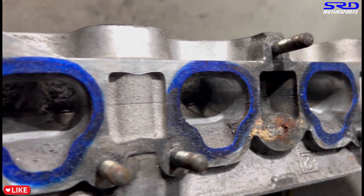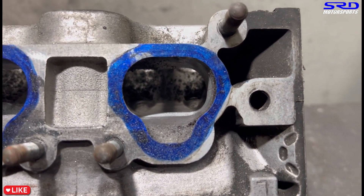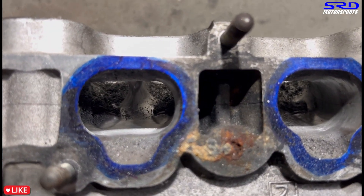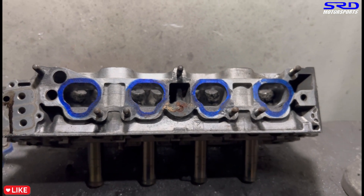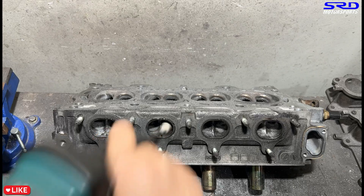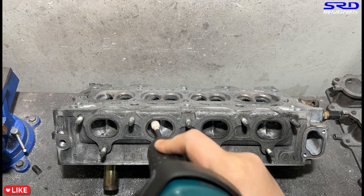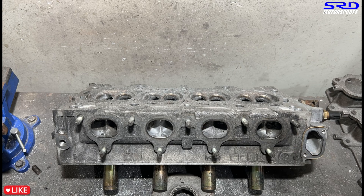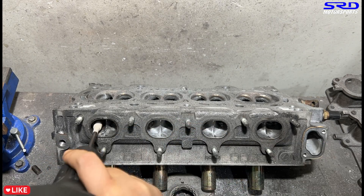Starting to get the shape that we want, but it's still not totally done, so it is good. We'll make a few more passes later, but for now we head back to the exhaust — look at that, it's starting to get there. Now let's flip the head back onto the exhaust floor. This is the second pass on the 80 grit — we keep making these passes on the second or third pass so we can get all the ridges gone. This way we can smooth to 120 grit. We do it properly so we don't maintain the casting ridge or the flaw on the cast itself.